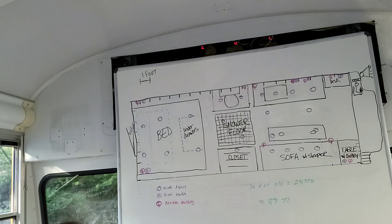Water tanks in the lower part of the bus will shift the center of weight down a bit — that's a great thought. We need more weight lower. With the cabinets we'll be putting up top, having more weight lower is definitely going to be good. We should not be afraid of 90 gallons. The only issue is when tanks are nearly empty they slosh, so we have to be careful on icy roads and fill up when we have the opportunity.